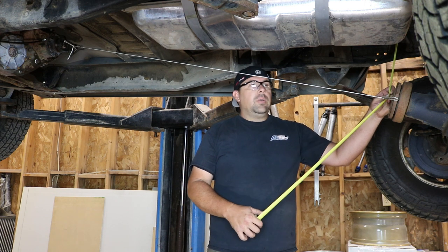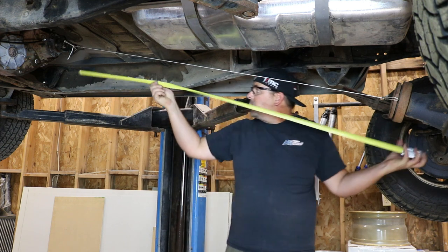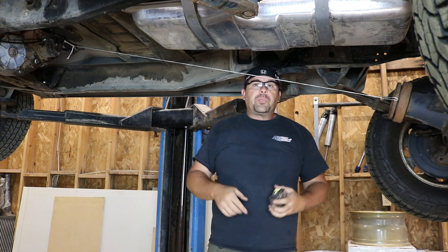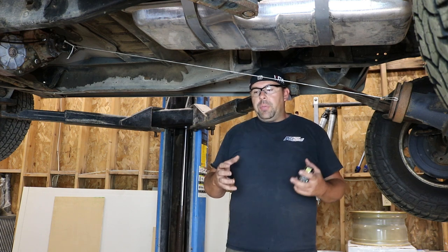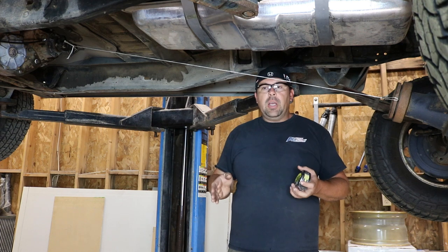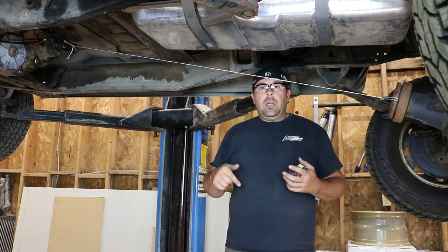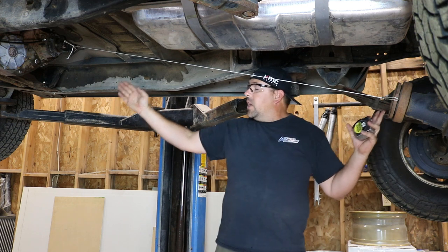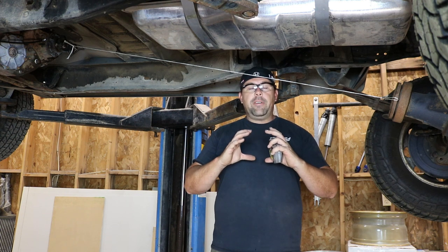For the video purpose, I put it up in the air for better visuals. One of the things you're going to have to be aware of is after you get the length — we are 65 inches. Drive shafts, as they get longer, have a lower critical speed. Critical speed is an oscillation or RPM where the drive shaft starts to whip and vibrate. At that speed, the whipping or oscillation can get so bad that the drive shaft will destroy itself. I'm going to put a link below to a Spicer website that allows you to figure out drive shaft critical speed. The longer the drive shaft gets, the larger in diameter it needs to be to avoid those oscillations — when the tubing is larger, it's more stiff and vibrates less.